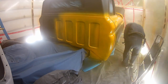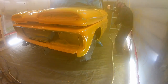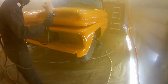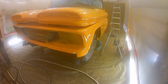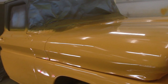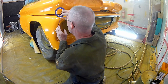Turns out when you're using a spray gun — in this case I'm using a DeVilbiss high volume low pressure gun, I like the gun — but for whatever reason it really seemed to spray a lot of overspray. And on all the videos I saw of how to set up your spray gun, they pretty much all say set your line pressure to whatever the gun recommends. I set it to 23 PSI, but apparently my regulator's pooched and I trusted the regulator. So it's hopefully thick enough that I can sand out a whack of defects. It's going to be okay. I don't build these for show — I wash my vehicles once a year whether I need it or not. Notice how the color changed — this thing does not photograph consistently. In some cases it's very yellow, others it's very orange. In this case it looks like pumpkin spice vomit. But there we are. Back to the retina burning orange — I like that.